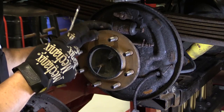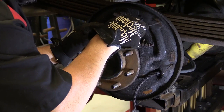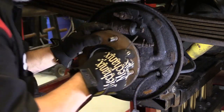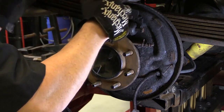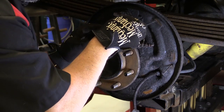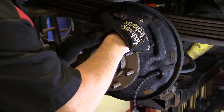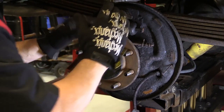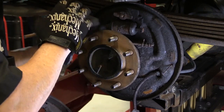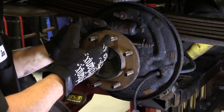Now that we have the shoes off, I'm going to be looking at the backing plate — this is where the noise is coming from. As you can see, the spots where the shoes actually rub on the backing plate are shiny. There's probably lube on a couple of them, but this driver puts his boat in the water all the time, so this whole assembly gets submerged quite often, which probably washed a lot of the lube away. There's a slight groove and a slight depression in there that we have to grind smooth. We don't want a groove in that backing plate because the shoes get caught in it — when you apply the brakes, they either can't get past that groove, jump past it and make a noise, or get jammed and keep the shoes applied the whole time.